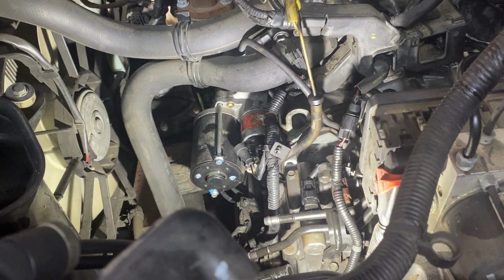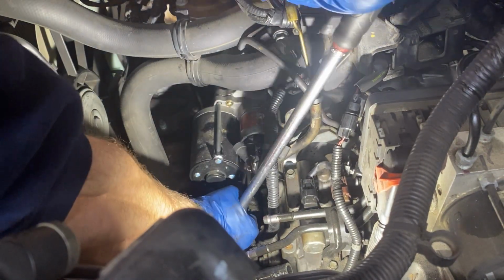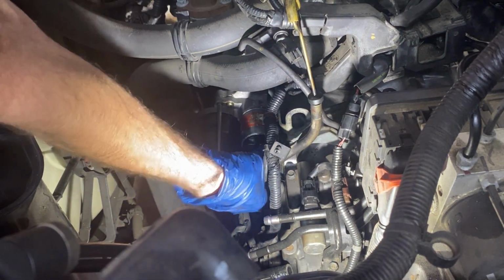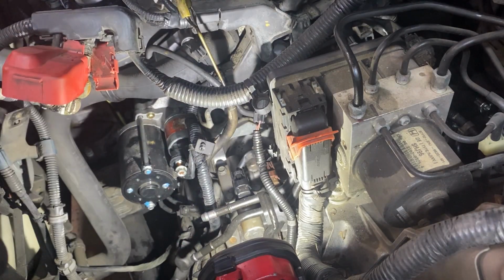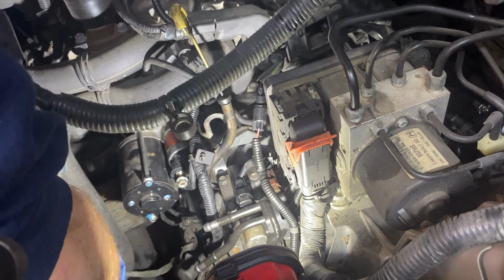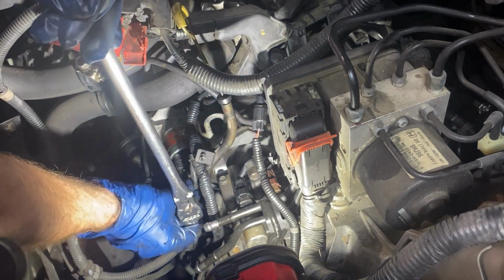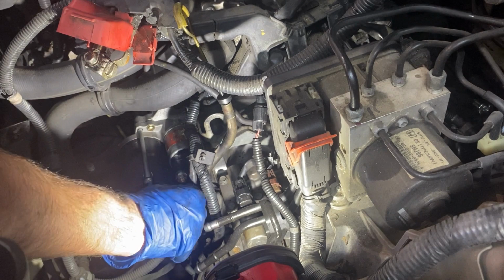Now, this third option is not something that I generally pick on Hondas because it can be very, very expensive. Buying a remanufactured transmission for a Honda can go upwards of $4,000, and that does not include the cost of labor to install the transmission. Now, in newer Hondas, this is pretty much the only option because not many people are rebuilding these newer Honda transmissions because there's not a lot of information out with them, and the good used market is slim pickings.